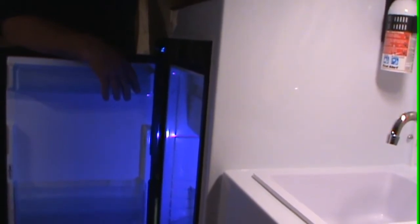Up here there's a spot for the microwave if you desire — there is already a 110 outlet in there. Now this here is your refrigerator. When you open it up, all you do is come in here and turn it on. The plug-in light lit means your refrigerator is firing up on electric. If I hit this one, the flame lights up and it's going to automatically ignite on gas — it has a self-igniter. When you're traveling down the highway you can put it on 12-volt. The only time you want to run 12-volt is when your refrigerator is already cold and your vehicle is hooked to it — it's basically a maintainer and uses a lot of juice.